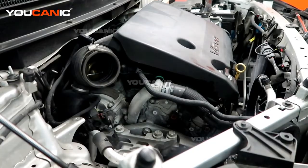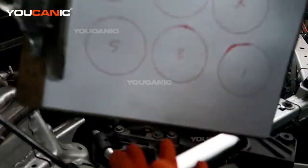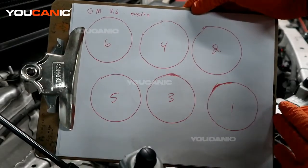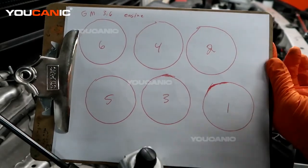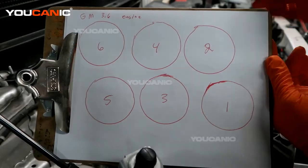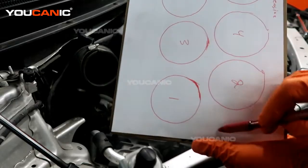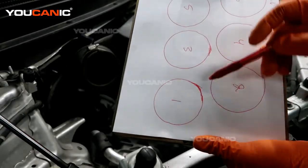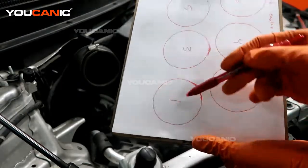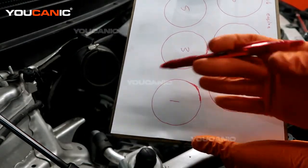That's an explanation for this 3.6 GM V6 motor. Looking at the diagram: if the engine were mounted for a rear-wheel drive vehicle, this would be the front of the vehicle, but this is a front-wheel drive vehicle with the engine mounted sideways. Either way, we can tell by looking at where the serpentine belt is — that's generally how we know which side is the front of the motor. And looking from above, you can see that one cylinder is closer because of the way the V works — it needs space to offset those cylinders.